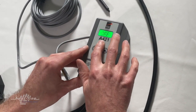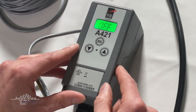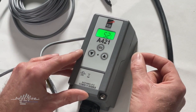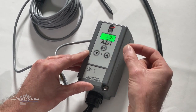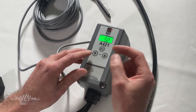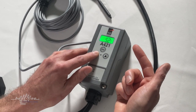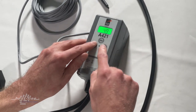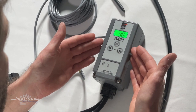Pressing the menu button, the first thing we see is the flashing 'off.' Pressing the menu button one more time, we get a flashing temperature. This flashing temperature is the current off temperature that is programmed. Using the two arrow buttons we can turn the off temperature up or down. For this demonstration, let's change it to 48 degrees — so we now have 48 flashing.